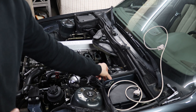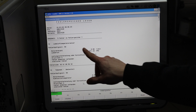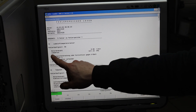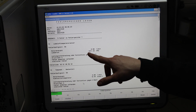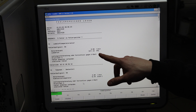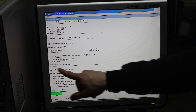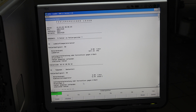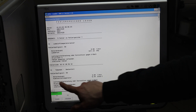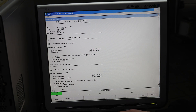With the car battery plugged in, the tiny ADS interface is already getting power. Now that we have INPA up and loaded we can read out the error codes. It says the air intake temperature sensor has an issue, and the boost pressure is at 1071 hPa — that's 1.07 bar, which is a bit more than atmospheric pressure. That's weird. It also says cruise control has an error, but my car doesn't have cruise control, which is also weird. And it says coolant temp is at minus 8 degrees, which is definitely not true — that is a short in the system.